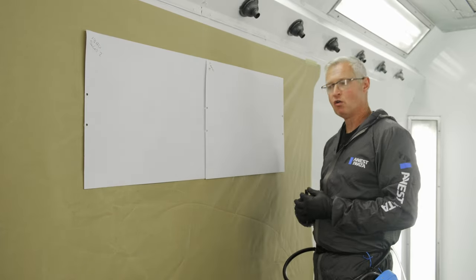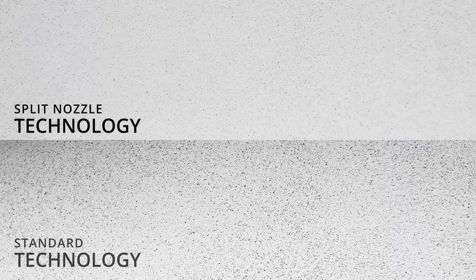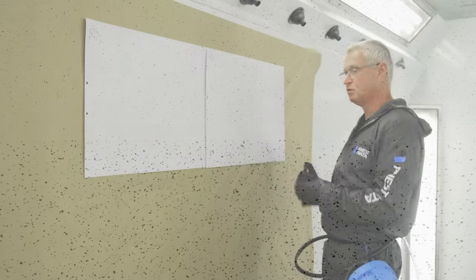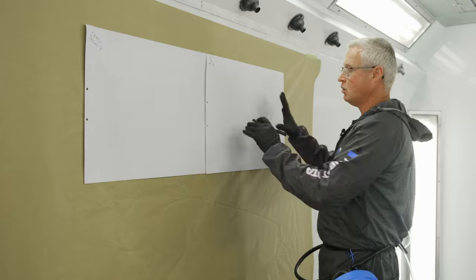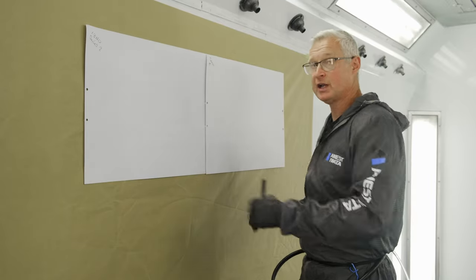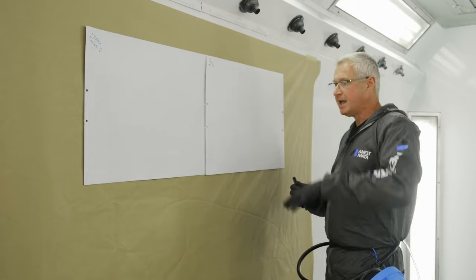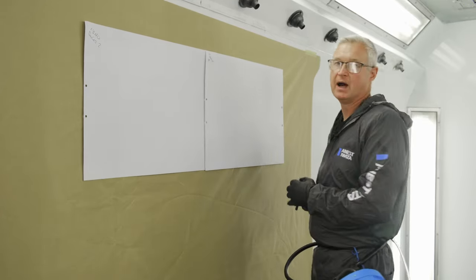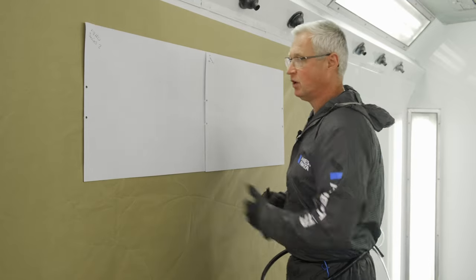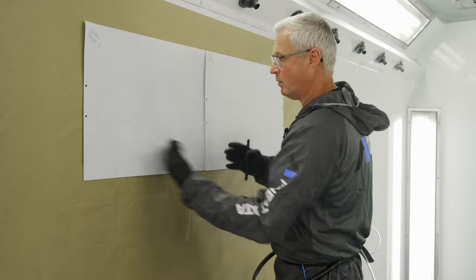What happens with this on the actual job is it sits there holding something inside — air, water, or solvent actually held in the droplet. This means eventually it has to escape. When you put it on bake or introduce heat, it can escape and pop through the base coat or clear coat surface, causing issues with the surface and overall appearance. It can also contribute to peel and texture structure on clear coat application because it's un-atomized.